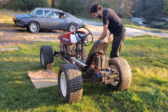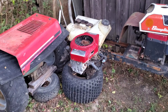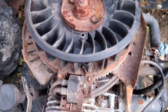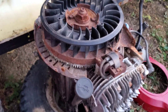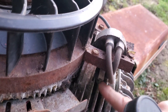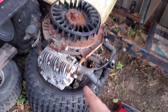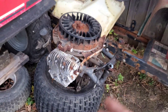Let's take a look at the Opposed Twin - it's similar, but different. The Opposed Twin is just slightly different in the sense that it has only one coil, not two coils. So you don't have to worry about a diode in the middle or anything like that. It's just one coil, two plug wires, and there's that little wire - the ground-out kill wire, whatever you want to call it. That's where you can get your tach signal from on the Opposed Twin.